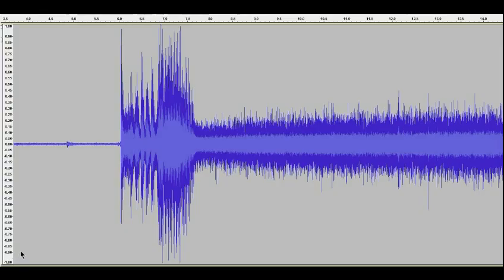This is an audio trace of the noise you just heard. This is the car cranking, so the starter motor pre-engagement noise is quite high as it goes in, and it cranks about 1, 2, 3, 4, 5, 6 times. And then you hear that very loud rattling noise, which then starts to diminish, and we learn later that diminishment is due to oil pressure coming up. And then the car runs normally pretty much after that.